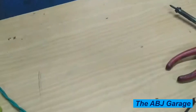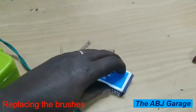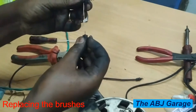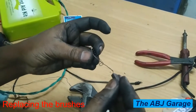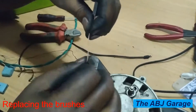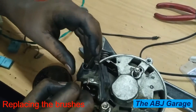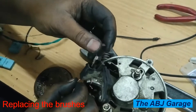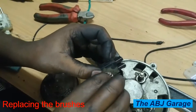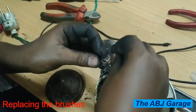So the alternator needs new parts. We are going to replace the brush, since as we saw previously the brush wires are broken and disconnected from the regulator — the carbon itself was gone but the wires were the problem. We simply insert the new brush in place of the brush holder and then solder it at the back, which will fix it. For the slip ring: if you have a replaceable slip ring, replace it as a whole. If not, you can fill the gap between the shaft and the slip ring and reinstall it. For this particular alternator, replacing the brush and soldering will fix the issue.